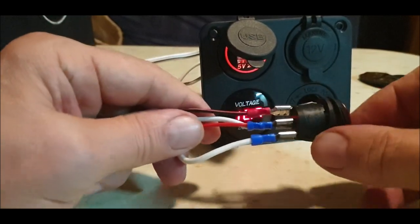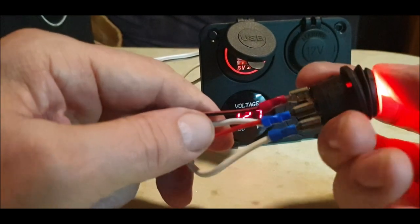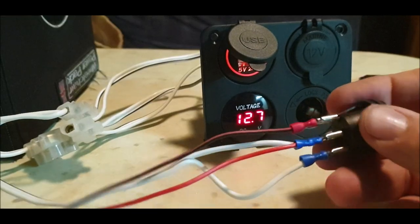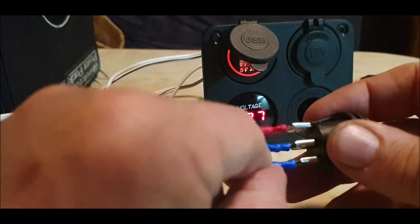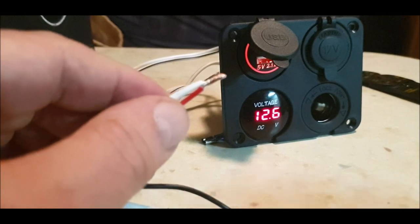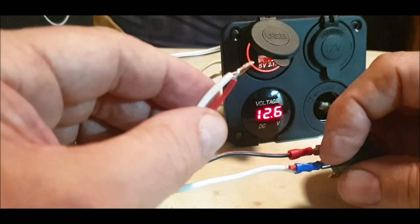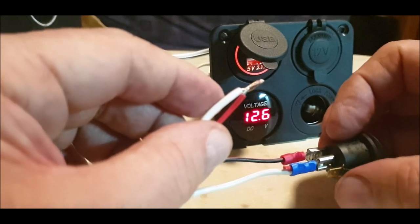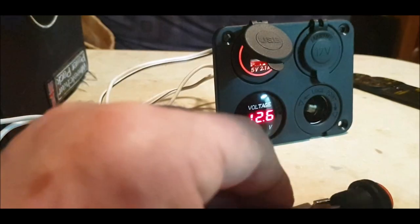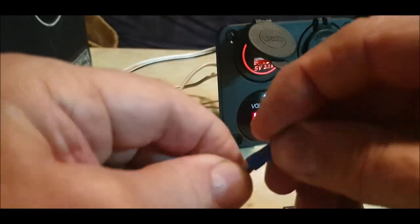So there we go. So as soon as I turn this on, we should have a light. No, we haven't. Why have I done that? Live. Right, okay, let me correct myself. All right, so I've got neutral to the top of the switch, live to the centre of the switch, and I forgot to realise that it's actually a switch, it's not a neutral or live, it's actually a switch, this bit, okay? So let me just put a connector on that. There we go.